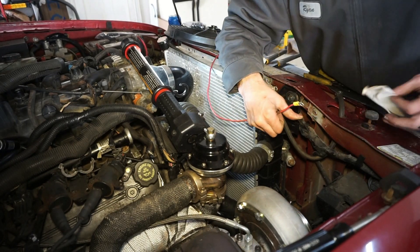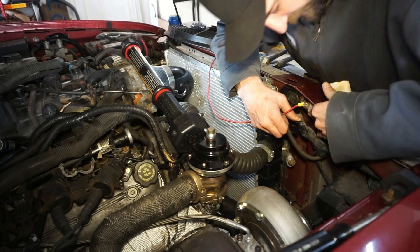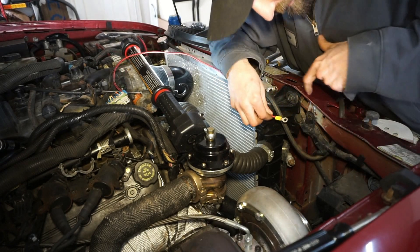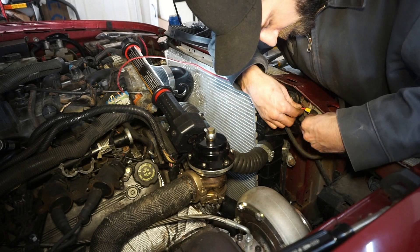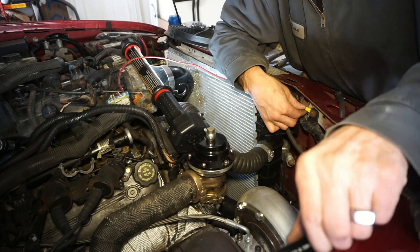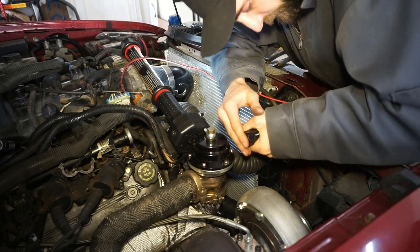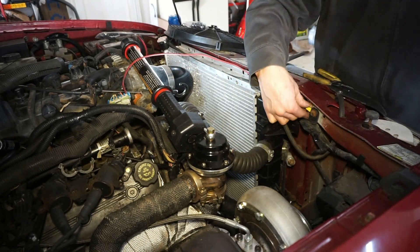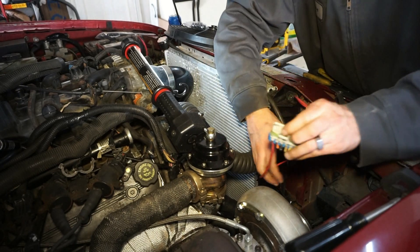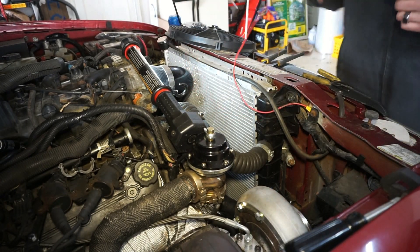I disconnected this piece, took some sandpaper, ground the metal down — grind all the paint off down to bare metal. I did have to trim a little bit of this plastic chunk off. I'm going to go underneath and jam this screw back in — this is just the 8mm. So now I'll be able to run the wire as long as I want to wherever the fan is going to go. That should be pretty good. Now I'll work on running the power.